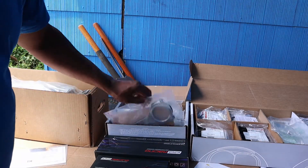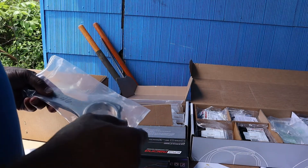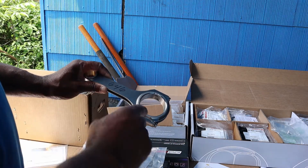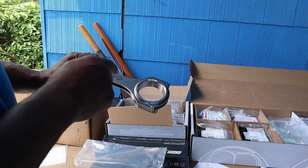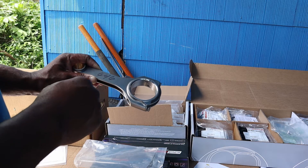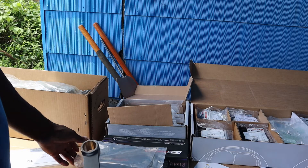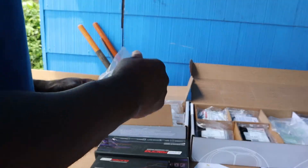Right here I have the rods. Now, like I said, the kit is balanced. But what I was anticipating them having on the rods was the weight of the rods. This is something that I did myself — I wouldn't just weigh the rods; I also weigh the pins as well. What I want to do is have everything weight matched. If you're an engine builder, you know what I'm talking about. I want everything weight matched so there's no vibration in the engine. Rods are made by K1 as well.